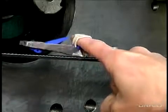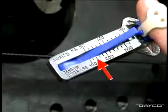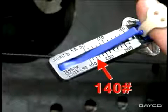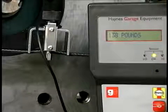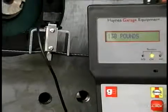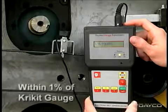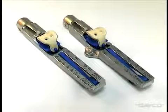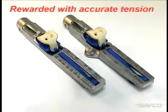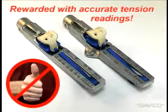Remove the gauge and read the belt tension by looking at the number where the top side of the pivoting arm crosses the numbered scale on the body. This reading is 140 pounds of tension. Here is a thousand dollar electronic tension gauge measuring tension on that same belt. This gauge registers 138 pounds, which is within 1% of the cricket gauge reading. The extra few seconds it takes to use the cricket gauge carefully and correctly will be rewarded with accurate tension readings, especially when compared to the much overused calibrated thumb method.